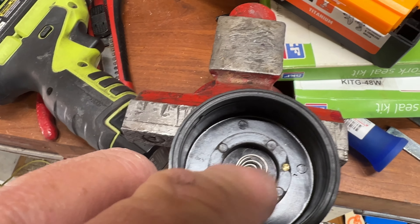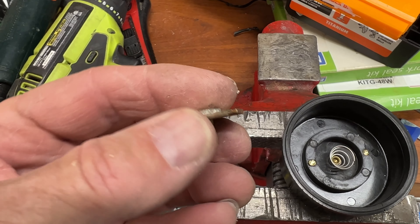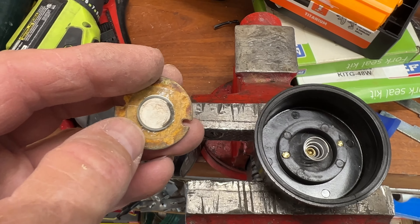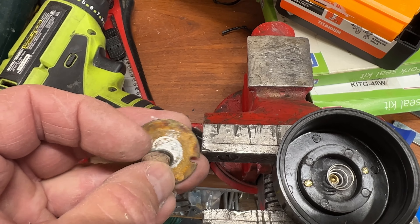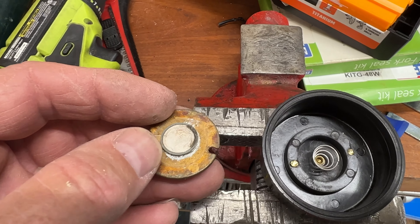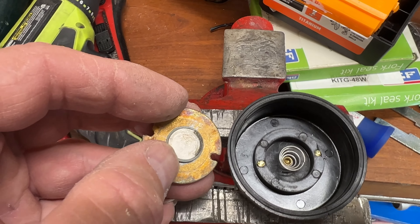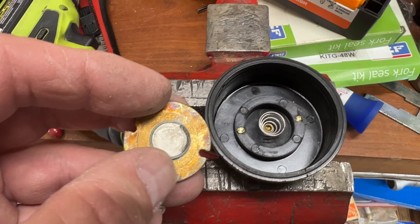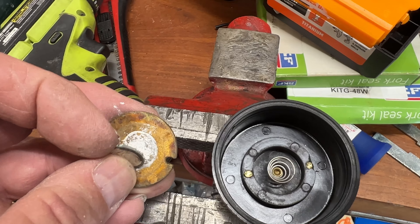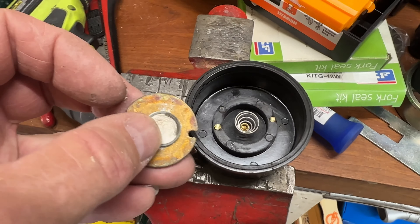This doesn't get hot anymore, and that's why I took it apart trying to figure out why. The spring is not the heater — I measured the resistance and there's essentially no resistance in the spring, no resistance in this material, and no resistance in the disk. I don't know how this thing gets hot. Apparently it has something to do with this white piece of paper, which seems to semi-insulate it from the rest of the assembly. It may be that the white stuff that dried up is the resistance element somehow — if anybody knows, I'd be interested to hear.